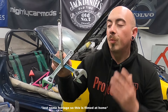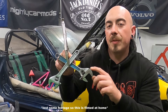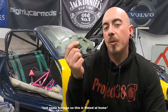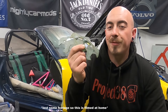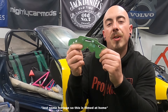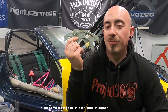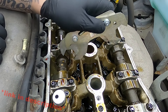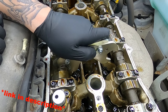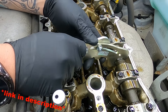With the engine timed up in top dead centre, we now need to lock the cam shafts in position. This is going to help keep the timing and make the timing belt easier to remove. There are a couple of ways to do this — there is a tool that slides in between the cam pulleys and locks all the teeth together, but if you are going to remove the cam pulleys to renew the cam seals, you would have to remove this tool and would lose your timing. Another method is two adjustable wrenches with a pair of mole grips — the adjustable wrenches sit on the hexes of the cam shafts and the mole grips lock the two adjustable wrenches together so you won't lose your timing.